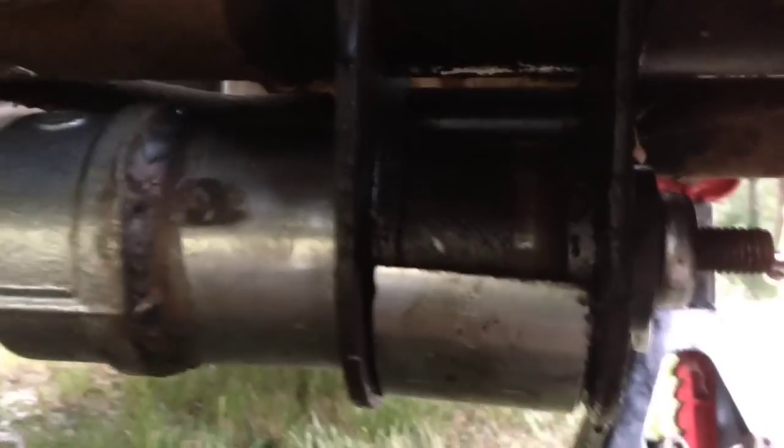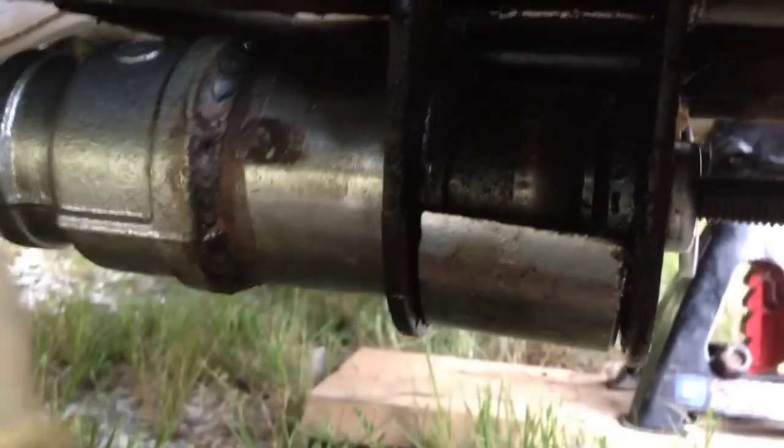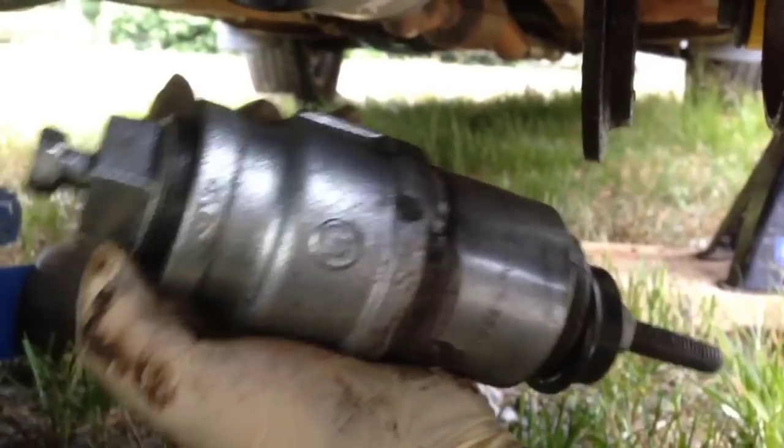After a little bit of persuasion, you'll be able to start pressing it out. As you can see, it is pressing the bushing slowly out of the axle. It will release once there's no more tension on it. It's important to choose an end piece that will slide through the eyes so you can get a full stroke. Once you've gotten to the end, it will lose tension and should just pull right out. There you go — you have the bushing right there. Unscrew the bolt and pull the stock bushing right out.